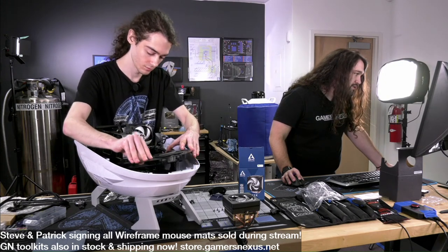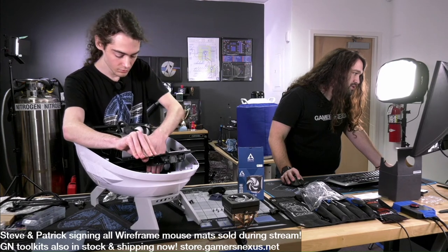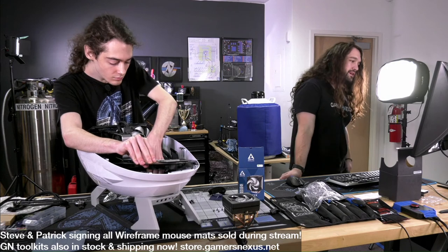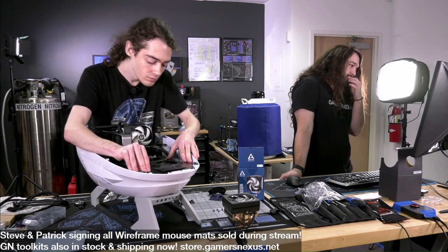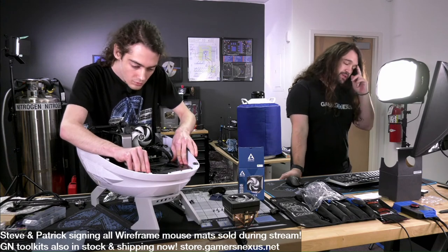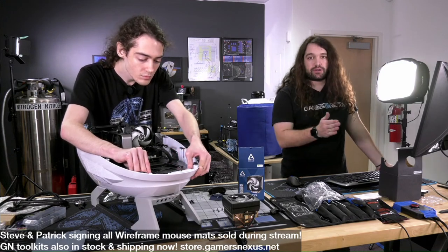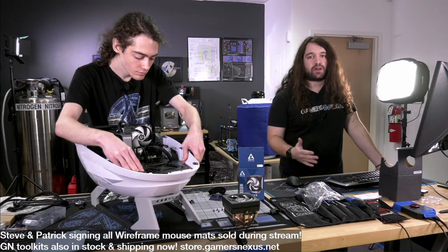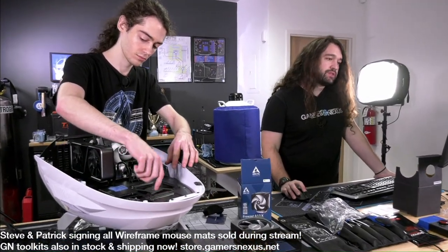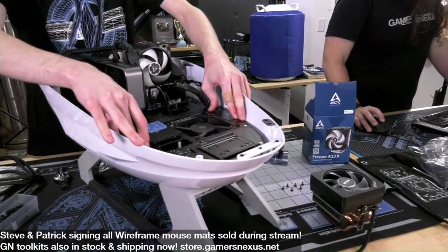$5. Should I look into undervolting my 3090? It gets quite hot. I have no idea how to do it. The easiest thing to do is to drag the power target down in the negative direction to like 95 or 90% power. That would probably help. You could also set a custom fan curve. That's the first thing I would do. Okay.